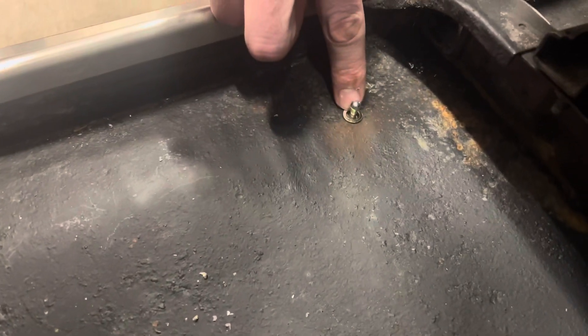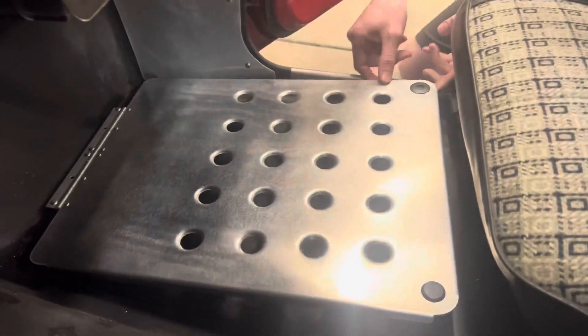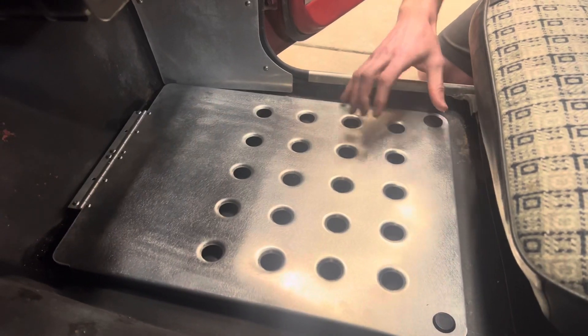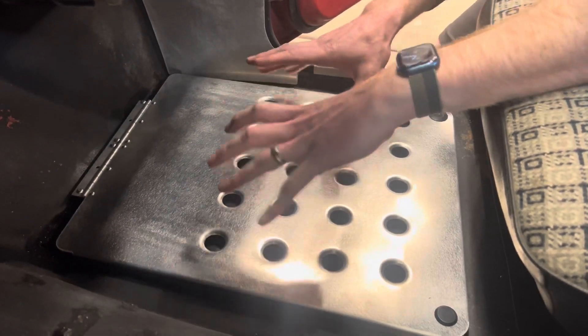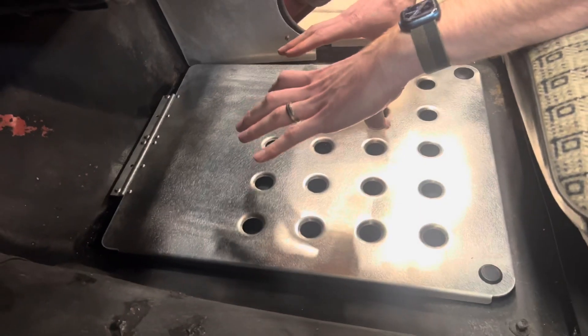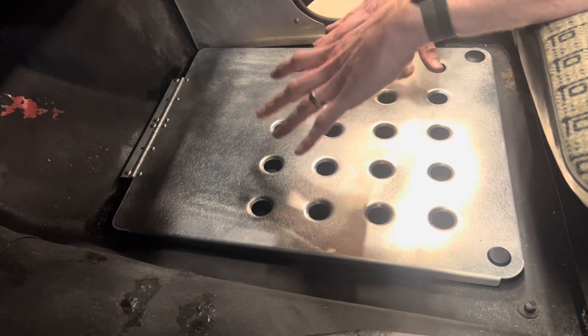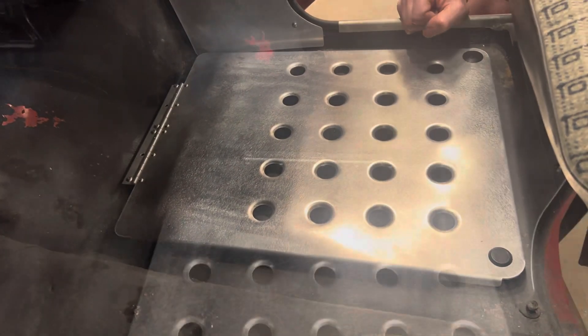Using a nut does raise the back of the heel plate up slightly. If you're using carpet, that wouldn't really matter, but I wanted it pulled down nice and tight. So I drilled for the M6, put the M6 rivnut in, then put the latch in, got it aligned and tight, and actually latched it into place. After making sure it hasn't moved, I move up toward the hinges and start that installation process.